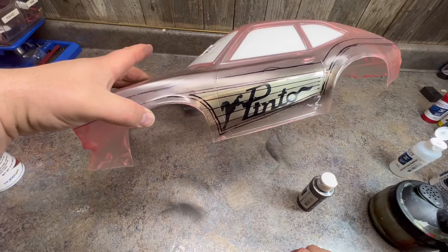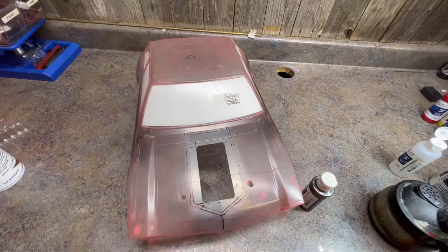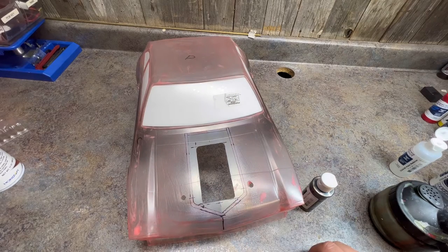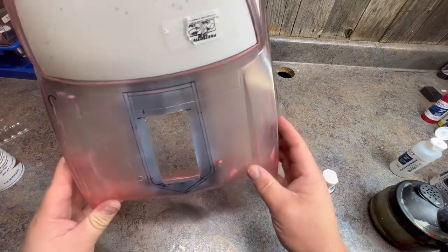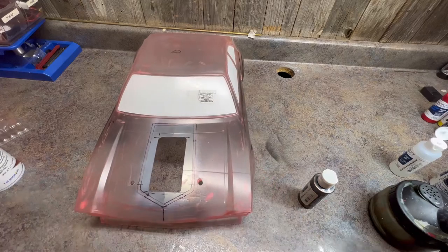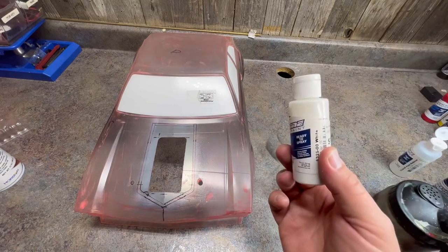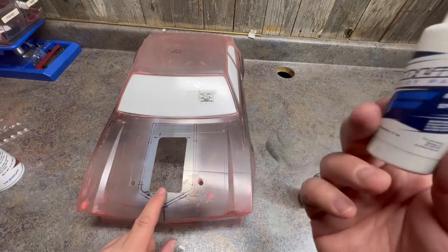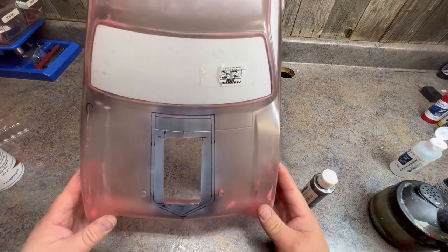It's looking really good, and this was supposed to be on both sides and on the hood. But you can see, I made a mistake, and I'm glad that I made the mistake on the hood. Can you see the blotchiness and how it looks really uneven? Well, for some reason I thought that I had backed another body I did with the white after I did the metallic pewter, the aluminum, and then did white. The white completely just went right through. I mean, look at this.